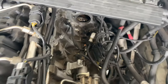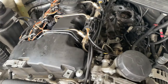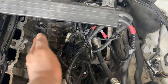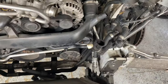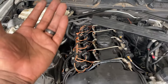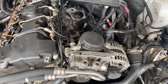We're pretty much wrapped up for day one — about three hours into this. Tomorrow we'll tackle the fuel system: connect the cut-off and have it off the engine, disconnect the power steering and AC compressor off the engine, then move to the other side and disconnect the transmission, remove the motor mounts, disconnect the exhaust from the downpipe, and we should be good to go.